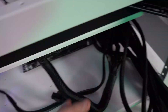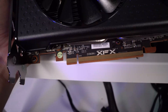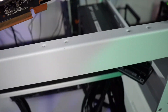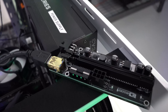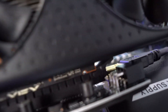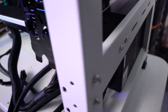The first card going on will be this XFX. We have a 16x slot on the riser and a 16x slot on the GPU, so we simply plug them together. You want to make sure that the butterfly clip on our risers clips up into the GPU so it's fastened and secure. The 16x butterfly clip is now upward, meaning this thing is locked in.